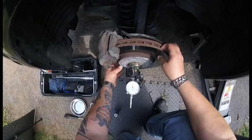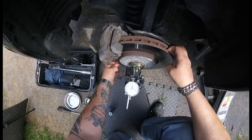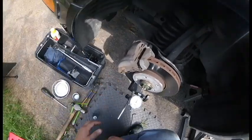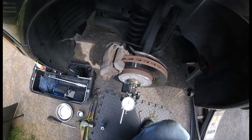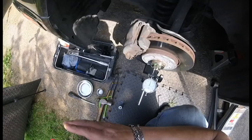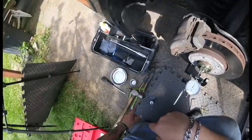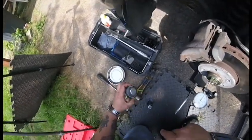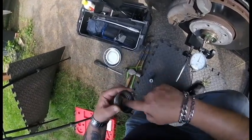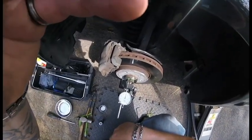That was my neighbors stopping by to say hello. All right, we're just a little bit under a thousandth on here on the end play — that looks like a good adjustment to me. I have new bearings that I'm going to do on this eventually, that's for another video. I just wanted to do the adjustment first and have the bearings on hand if I hear any kind of bearing noise or whatever. I'm going to throw some red high temperature grease in the cap — it's not Mercedes green grease, but it is high temperature bearing grease. That's it for that wheel.